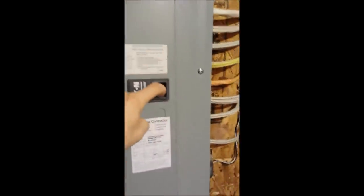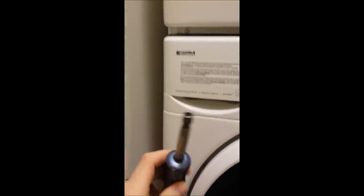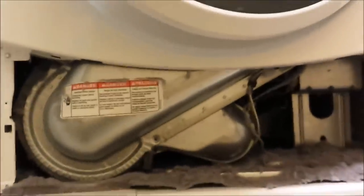I'm going to grab the vacuum now and clean up the dryer. We're going to use a quarter-inch hex screwdriver to remove the two bolts securing the base of the washer here. We're going to remove those and then remove the front panel. So I removed the front panel and you can see there's a whole lot of lint that has been collected here. This represents a fire hazard.